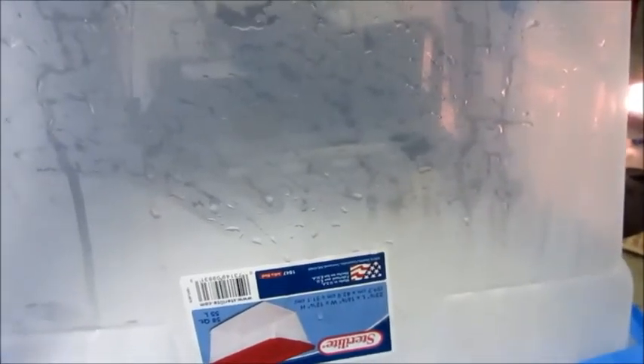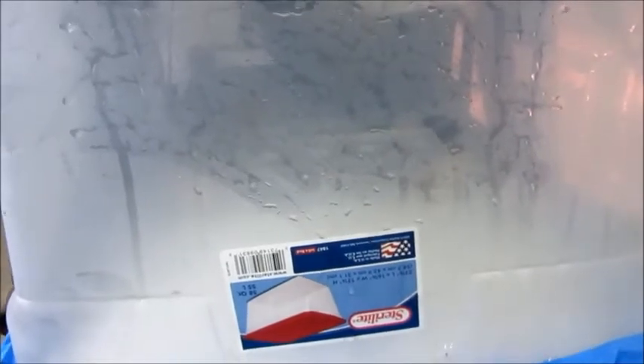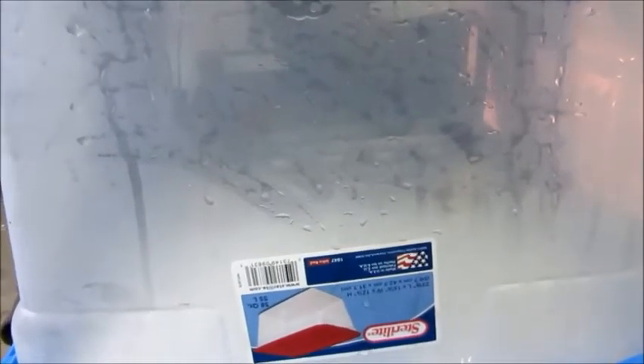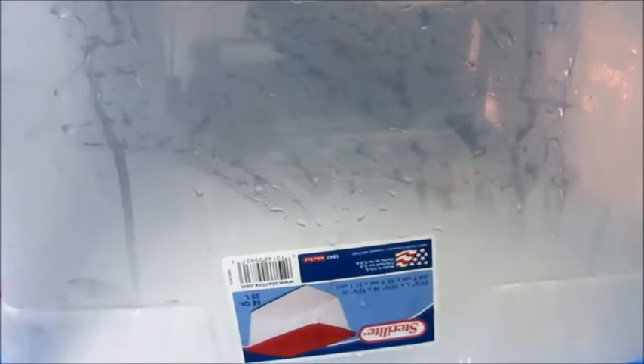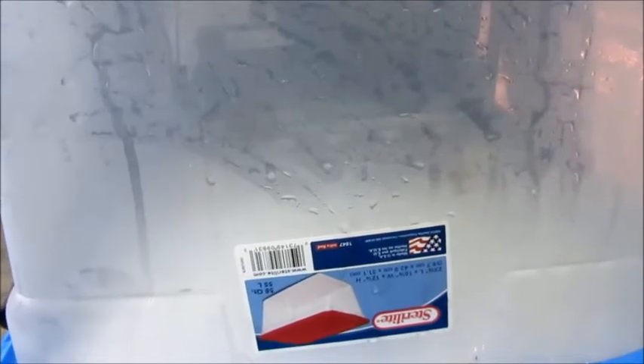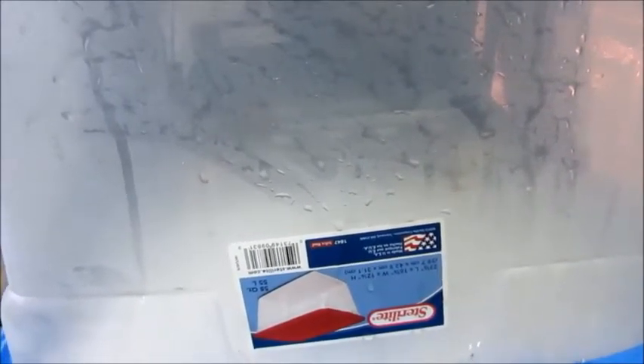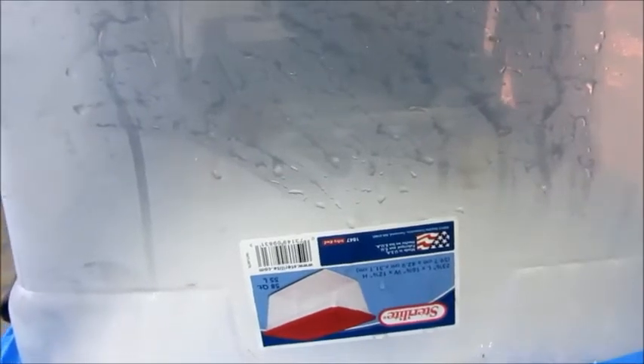If it had a bunch of drinks in there it would have had a lot longer cycles, but the temperature should have still more or less been constant or cycled at the same points. The key to this system working is it has to cycle above and below the freezing point so the coil will defrost, but then during the run cycle it needs to get well below that so your drinks are cold enough, since it is meant to be a drink cooler.